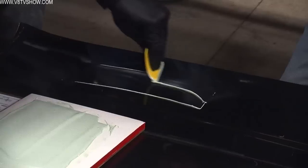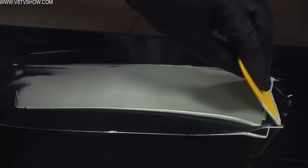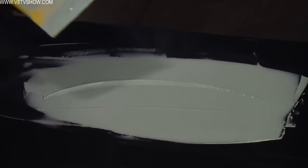Again, air bubbles. When using the Quantum One product, Evercoat recommends a process called a tight wipe, where you take a very thin layer of filler and just scrub it along your panel, then go back and apply it again with a little more thickness. This kind of preps the panel and gives the filler a tacky surface to stick to.